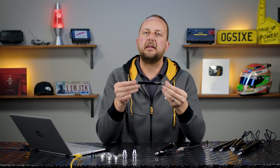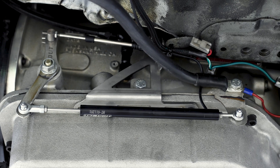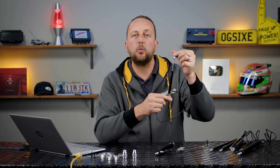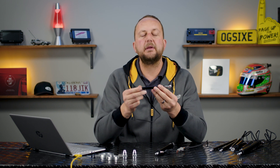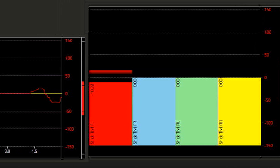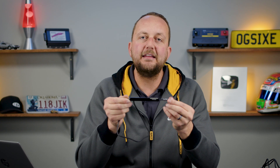Once we mount this on, let's say, a shock platform, or we might want to measure where our gear position signal is, or our park-reverse-neutral-drive selector up inside the cabin — we might want to measure the angle of an active aero wing, something like that. We can mount this sensor then put that signal wire into the engine management system, do a calibration, and determine exactly what's going on with those moving parts. Once calibrated, we can data log and view the measured length across the calibrated range as well as the derivative — the rate of change — which is perfect for things like shock travel.